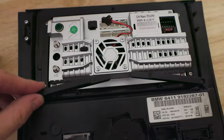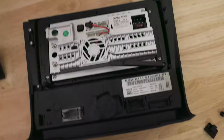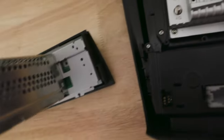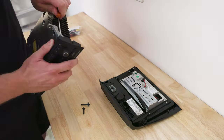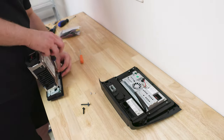I also mentioned using the old radio as a donor unit — basically this head unit doesn't come with any screws, so you're just going to end up taking them from the old radio. My other tip: make sure you use good quality screwdrivers because they are tiny screws and you cannot get any traction out of them with a poor quality screwdriver.